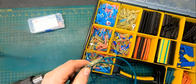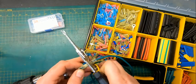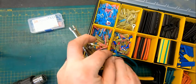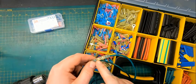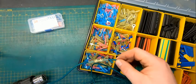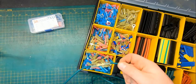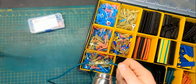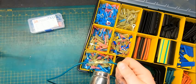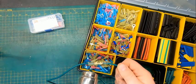So they're great for boats and things that are outdoors and even cars under the hood and things because it pretty much keeps them pretty dry, but you still have a friction hold. So the pinch of the metal that's inside the sleeve here is what keeps your wires from coming apart. You do have an added bonus though, the heat shrink here, since it has a little bit of glue in it, it not only keeps the moisture out, but it also helps keep the wires from tugging. So you can see here, we're just going to melt it on down.